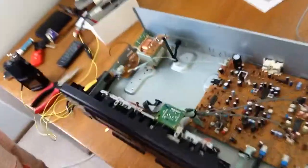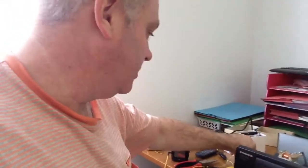When I press forward or rewind, nothing. So I opened it up, as you can see, and it's mostly empty space. What I found was the drive belt — this one was broken. And the other one, there's one for each side. The other one had come off the wheels. Anyway, I managed to put it back on, and the one on this side works.